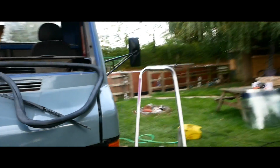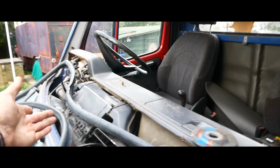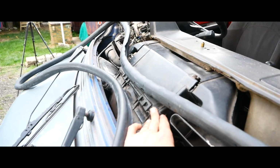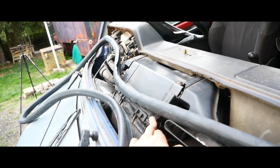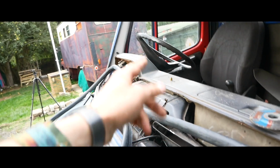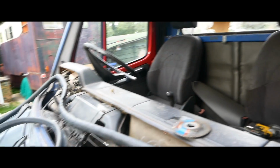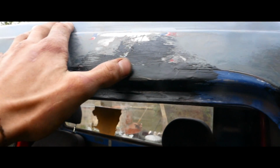Okay, so hello everyone, it's the next day because we ran out of time fixing the blower motor yesterday, which now works only on setting 1. It wasn't a blower motor that was broken, it was all the rusty components and connections inside, so we just bypassed all the resistance. There was only one resistor anyway, and now it's just straight on or off, not 1, 2 or off.